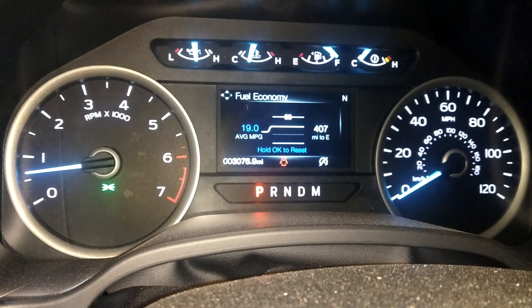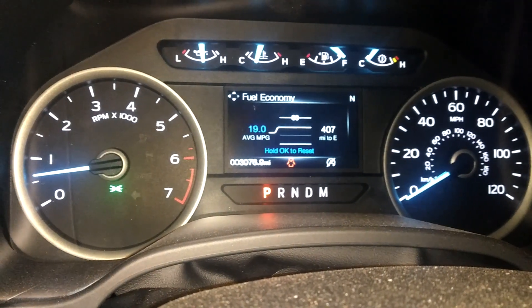No power. So hook up this test light to the passenger side lead of the trailer wire. Come back inside, press the brake, and turn it on — but the computer is smart enough to realize that only the right side is working, not the left.